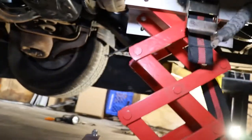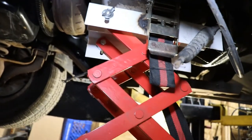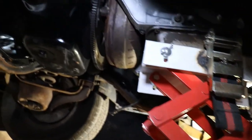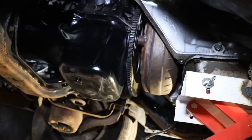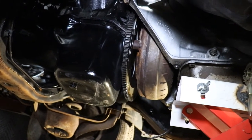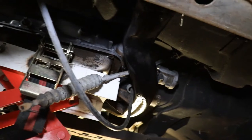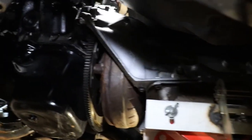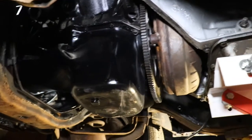Light on the subject. So it's in, a couple bolts holding. I gotta hook up the torque converter bolts. I gotta hook up the shift cable and the speedometer cable and get the drive shaft ready to go in. I'm gonna do a little bit of cleaning up under here. Try and shoot a little paint on it, make it look good at the bottom.